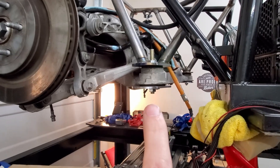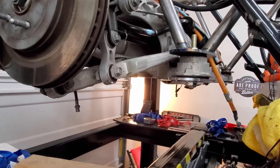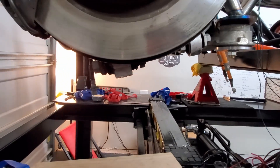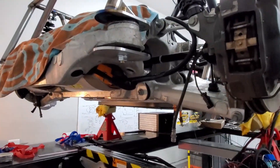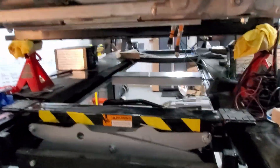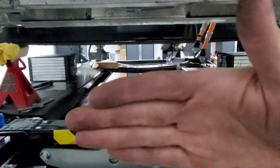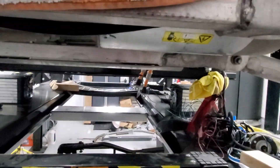So I got all the plates kind of tightened up. There are a couple spots where as it's sucking up, it's starting to run into the aluminum Tesla subframe, so I had to kind of shave off some corners. I did some measurements — left to right, it's dead center. Front to back is fine. Height I believe is fine too, though we won't really know until we get some wheels on it and put it on the ground to see what sort of height adjustment we have on these coilovers.